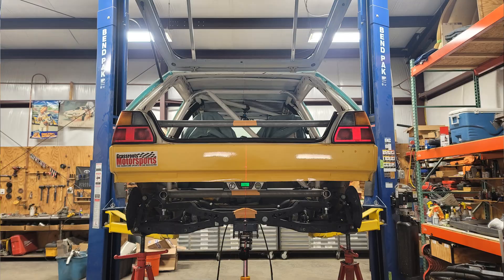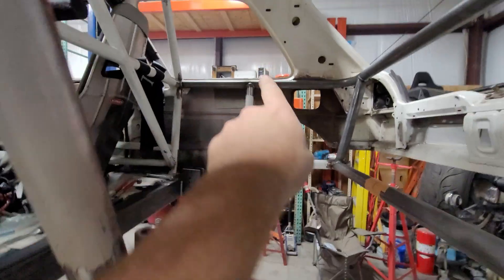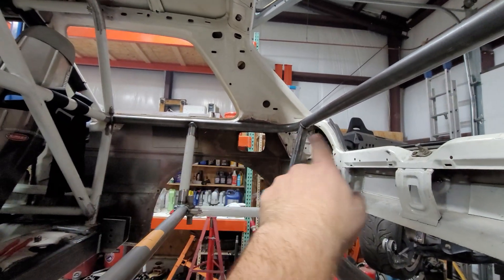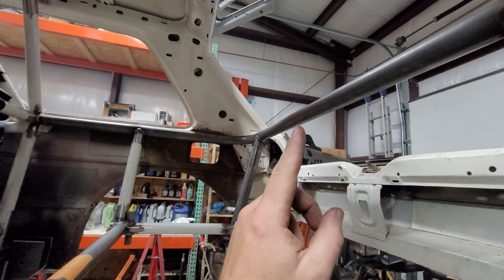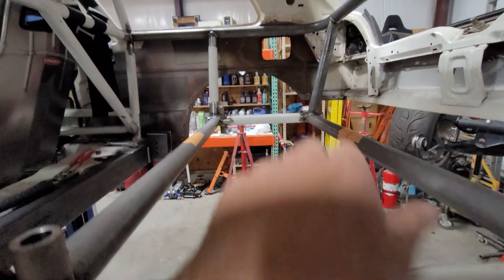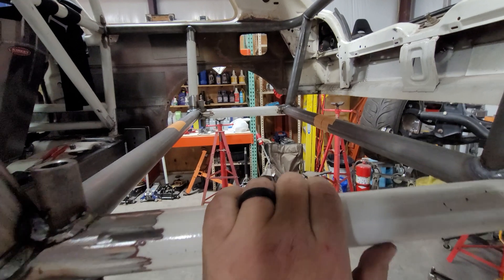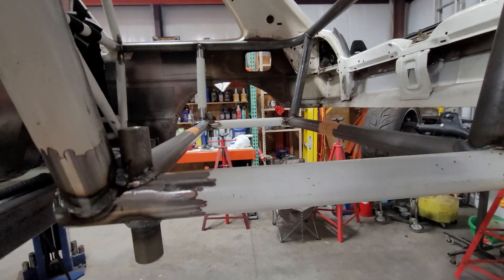I'll show a photo of that. Long story short, I was able to reuse some of the down bars — that's why all this stuff is painted white. That was from the cage where I cut everything out. I ended up with kind of a round, almost like top of a basket is what I'm calling this thing, which ties the actual chassis together with this tube. Then I built a rectangular box, added some studs. I'm using 5/8 bolts, which are very close to the metric size. There are four tubes now, but there's a pile of other tubes that still need to come in, so this just gets the thing sitting in the car squared up and it'll carry a little bit of a load.